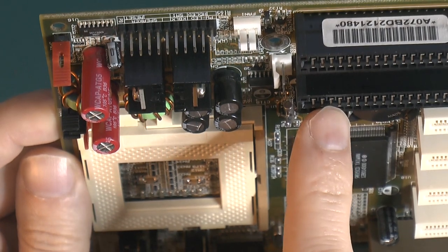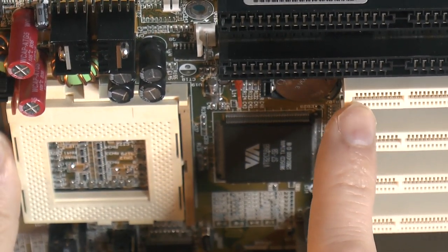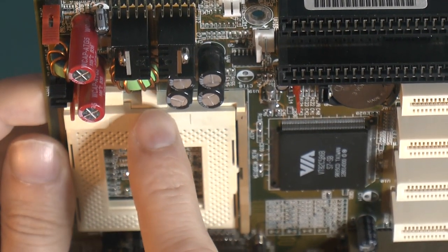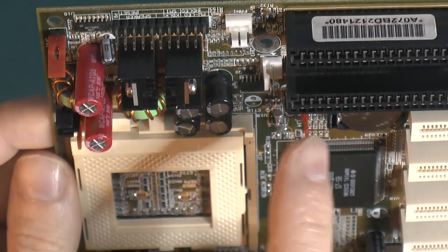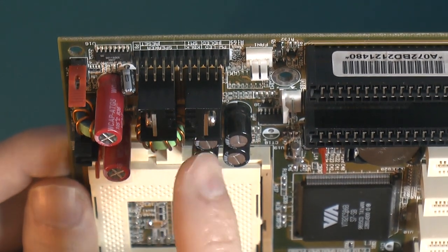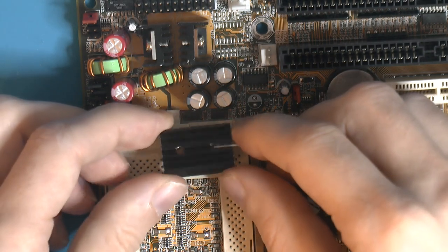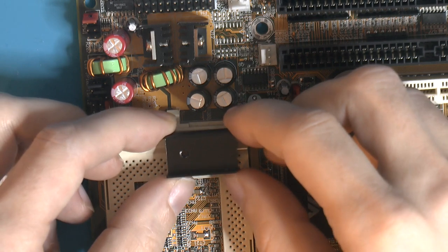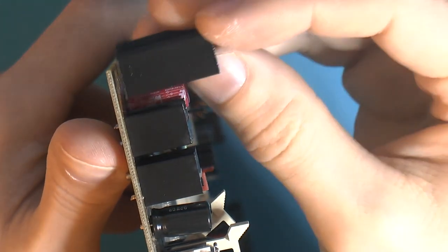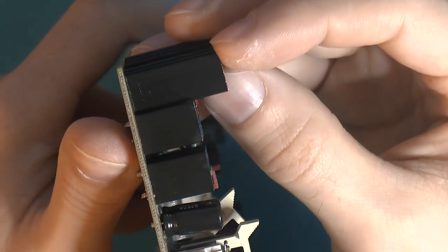The heatsinks are about 15mm tall, which just clears the ISA slot. I don't care too much about the ISA slot because we have the PCI slot over here and that's the best one to use. Long cards will either catch the clip of the cooler or go past it if you have the right small cooler with a low-profile clip — so it's not really an issue. I'd like to replace these with taller heatsinks, which is also why this video is late compared to what I usually do — it took forever to get the right ones delivered. The new heatsinks are very similar, almost identical to the original but about 66% taller — 25mm instead of 15mm.